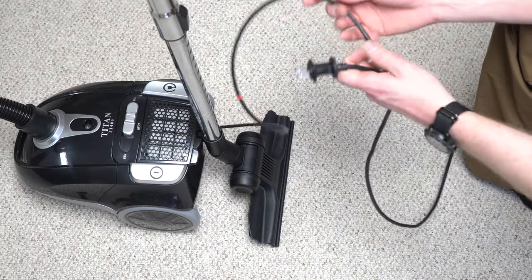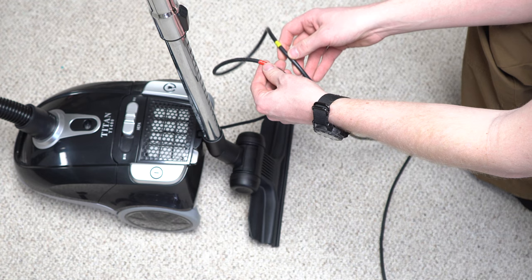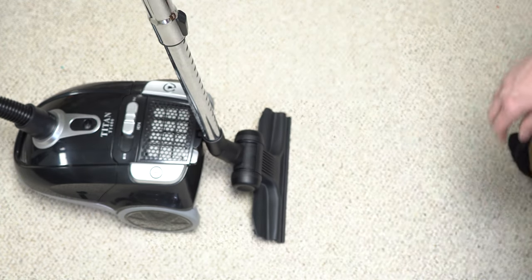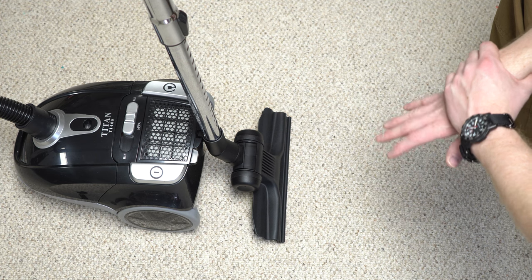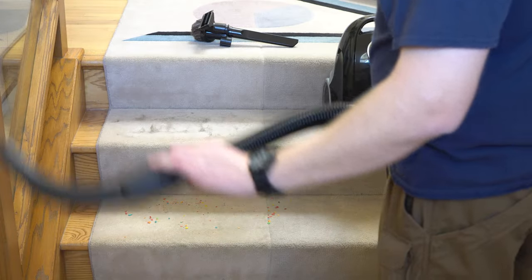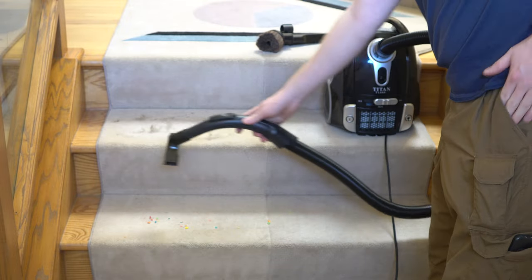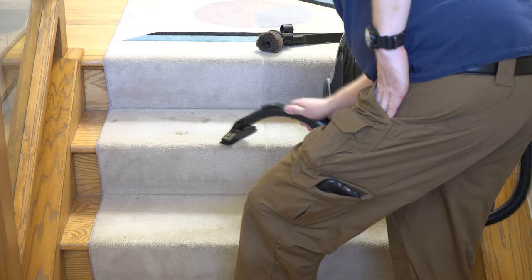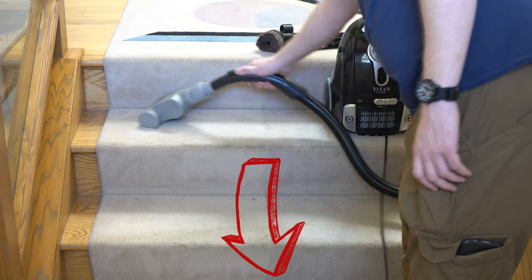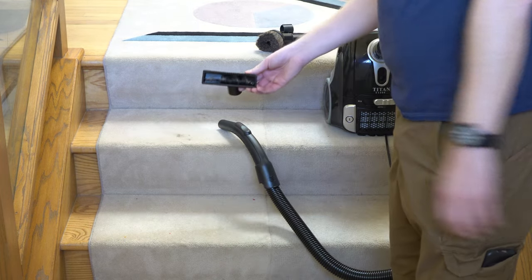Some things for longevity: the cord has a nice bumper so when it hits the machine it's not putting too much stress on the cord, and it's clearly marked where the end of the cord is with yellow and red tape. The cord reel is strong at first, but there's no counterweight, so going in you might need some help the last six inches. The machine balances very nicely on stairs, and they give you some really nice attachments. With some pet hair and breakfast cereal on the stairs, if you're doing a lot of pet hair on stairs, you'll definitely want to get a turbo tool — I'll have a link in the description. A lot of the hair does get stuck in the lint pickers; however, for big objects and fine dust, it's just fine.